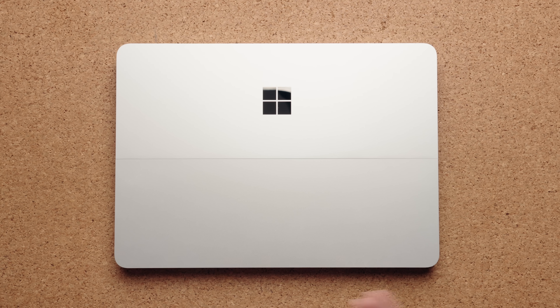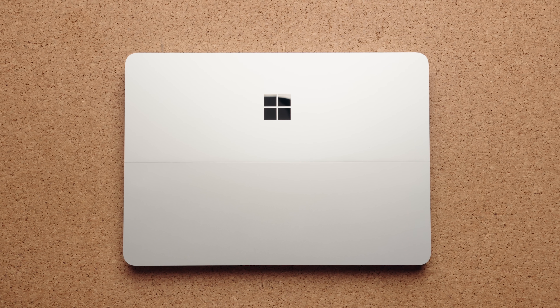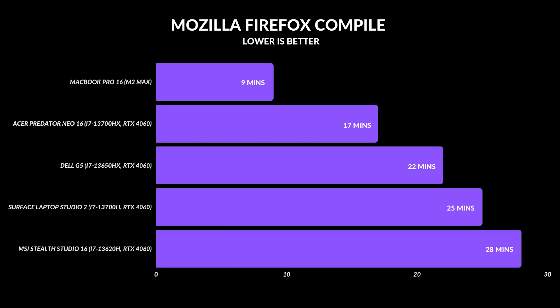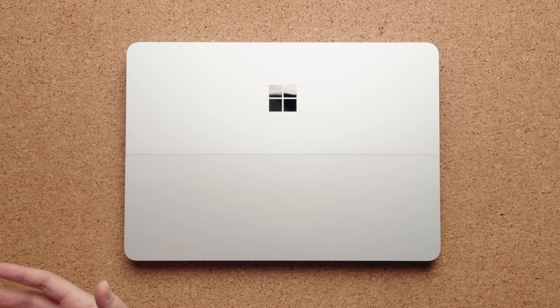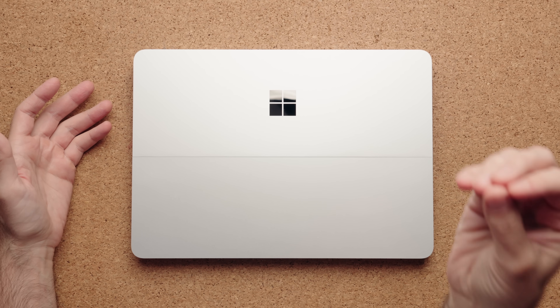It's great that they're using the latest 13th gen processor — usually Microsoft is a year behind — but it's still not running as fast as other comparable Core i7-13700H CPUs. Microsoft is limited because of their design choices: they want a gorgeous, thinner design with low fan noise, and to achieve that they sacrifice some performance. They're not using ARM chips like Apple, so they don't have that opportunity to deliver more in a smaller chassis. AMD would have been a better choice, but AMD has supply issues whereas Intel always has plenty.